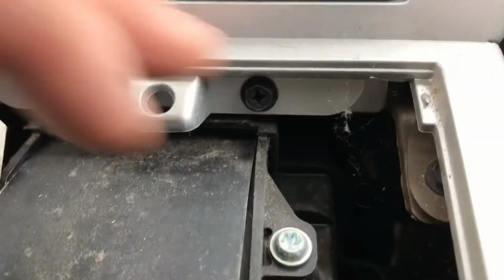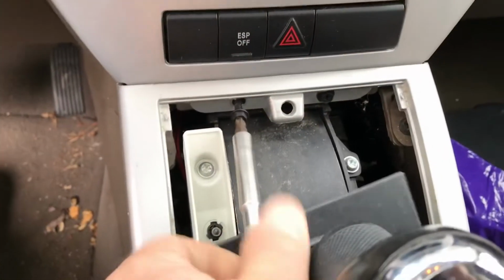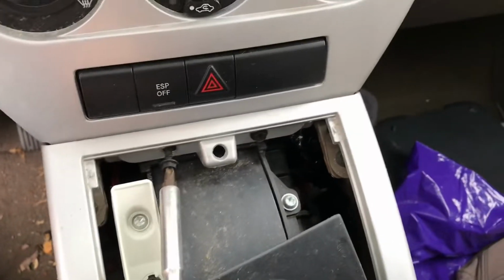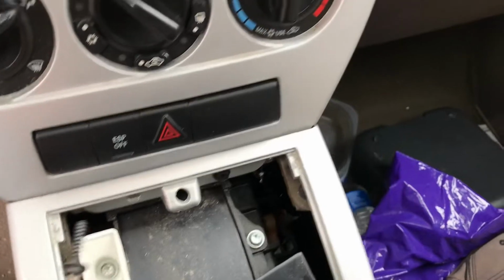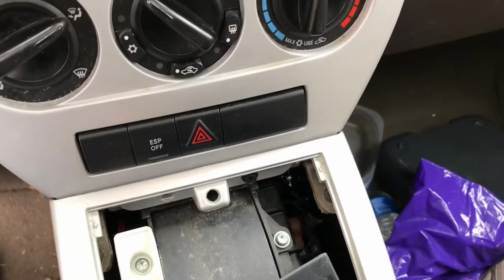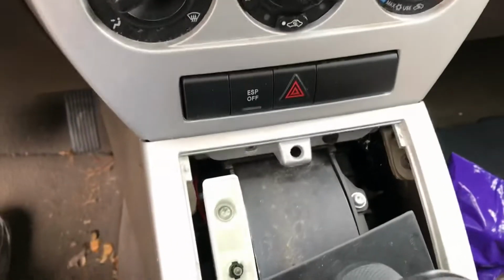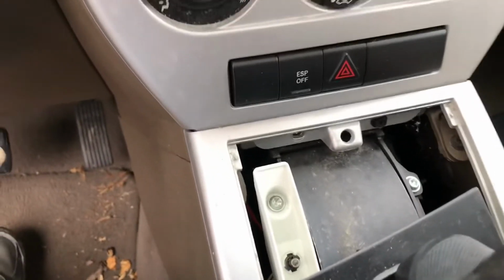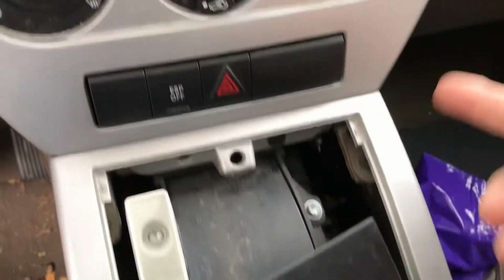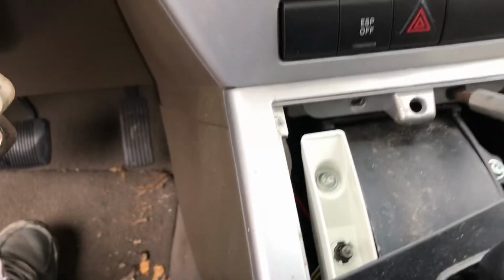Two screws we're going to be taking off are here and here, so that makes it easy to get to those. Screw removal with a Phillips head screwdriver. Get this to come out. I think the term the other guy I'm watching is using is calling this plastic piece a bezel, a term that I'm not overly familiar with, but if that's what they call it, that's what they call it. So I'll take the other screw off here so we can take off this bezel, and this bezel gives us an outer trim there, and we'll be able to get to the radio from there.